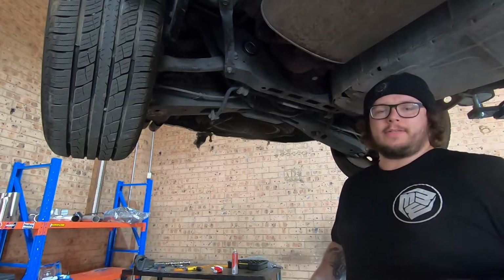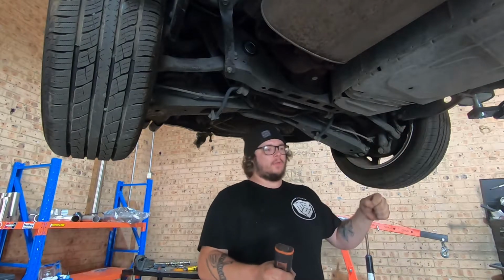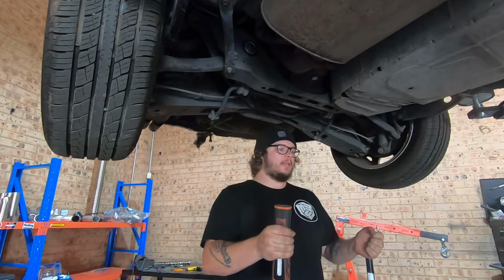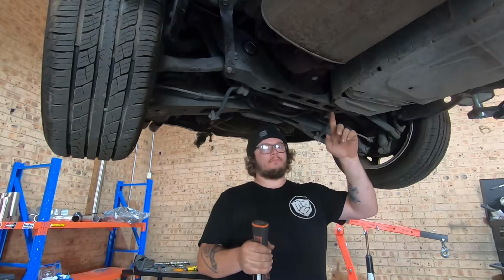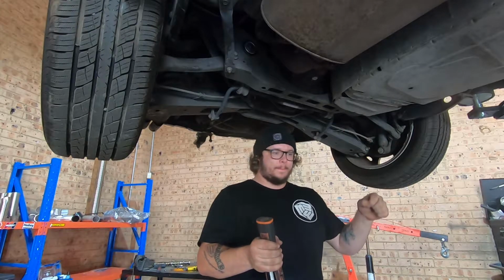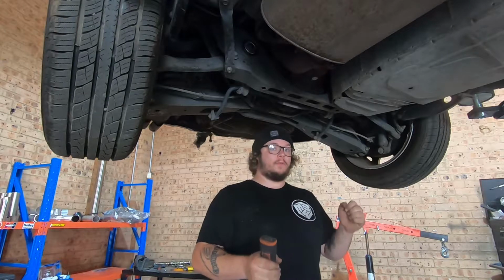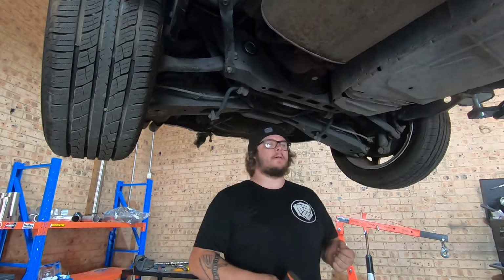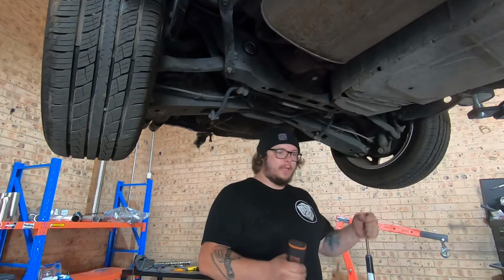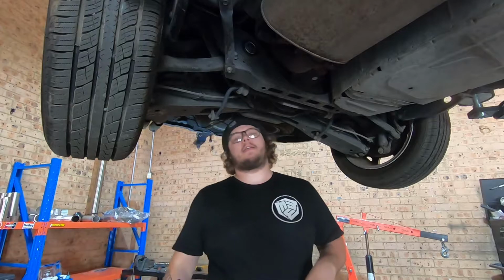Alright, an easy way to tell is jack up, say, the left rear of your car and see if you can turn the wheel, with it in neutral of course. Turn the left wheel back and forth. If you can turn it back and forth, it's probably an open center. If it binds but sort of breaks free and then moves, you've probably got an LSD.